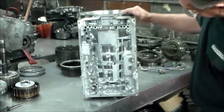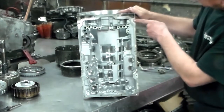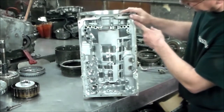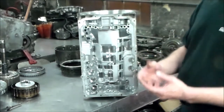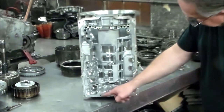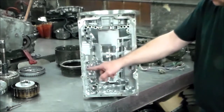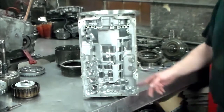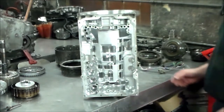I drilled out and put coils in, 1, 2, 3, which came out good, and then one of them didn't come out so good, so I'm going to put a nut and a bolt in, which is fine because it'll fit. And all the rest, I put the 6x1 chaser through just to make sure those threads are good, and we're going to load it up with Never-Seez when we put this back together.